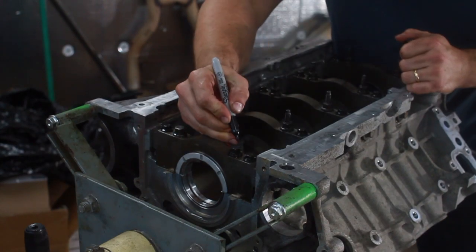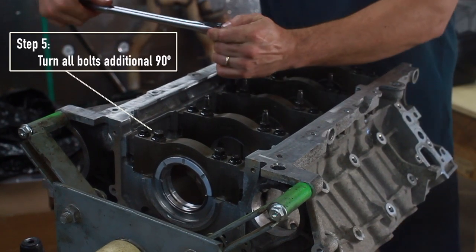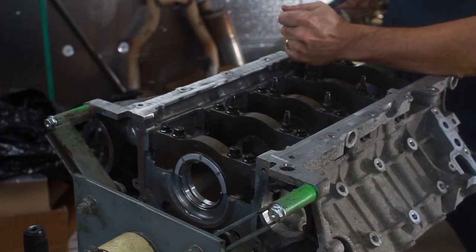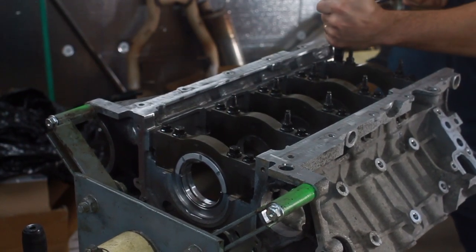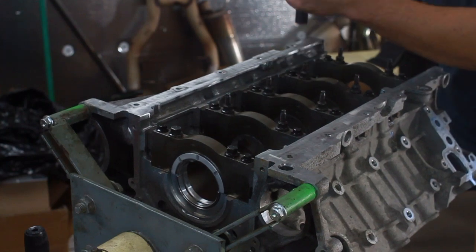and knowing this build was probably only going to make about 400 horsepower with no power adder, I did feel comfortable just going with the stock bolts. I know of a lot of guys who track these cars regularly with stock internals, and the bottom end of these engines is not the weak point. If anything, it is the valve train. And so that's why I made the decision to allocate my budget toward valve train upgrades and the GT500 oiling system.